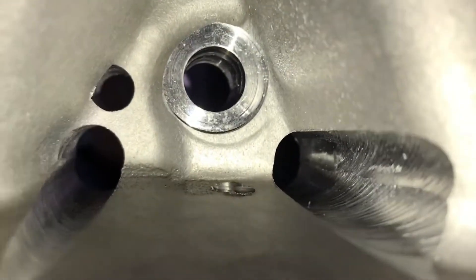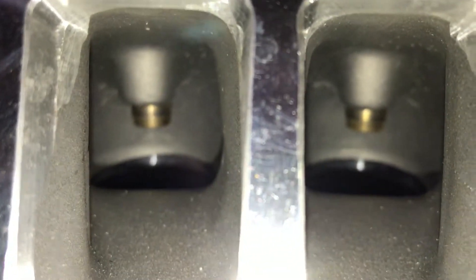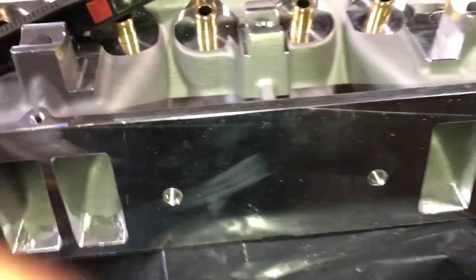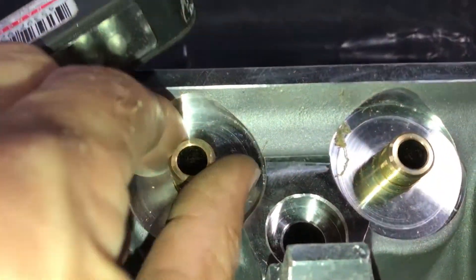You can see the push rod hole, but there's actually some meat there. You can't go too far with a push rod, but according to the cast port size there's not much in the way up here. You can smooth that out — there's one little bump right there — and if you wanted to widen this you'd just take the meat out as far as the gasket would go. If you're gonna put some boost to it, just blend stuff up and go to town.